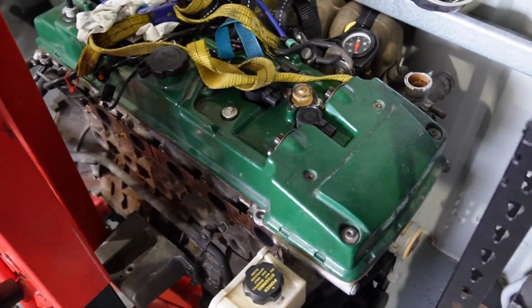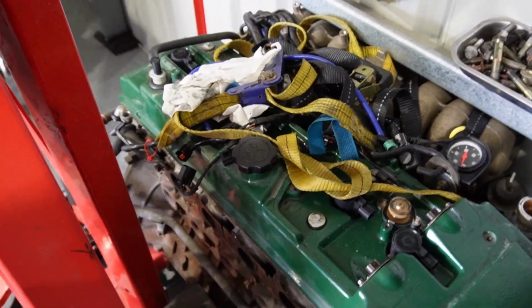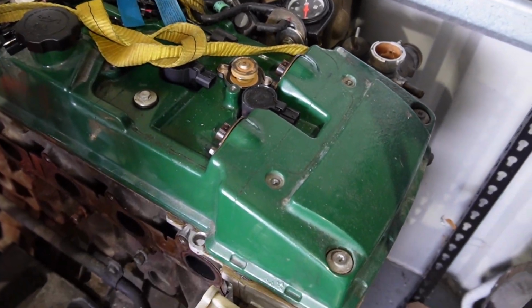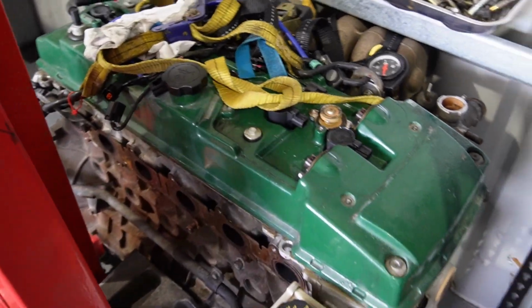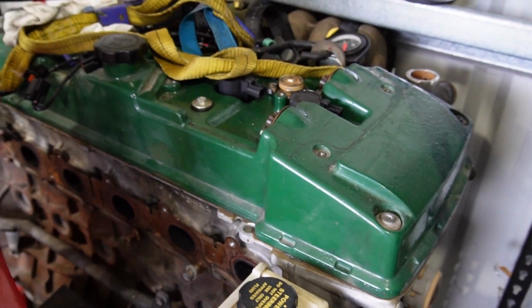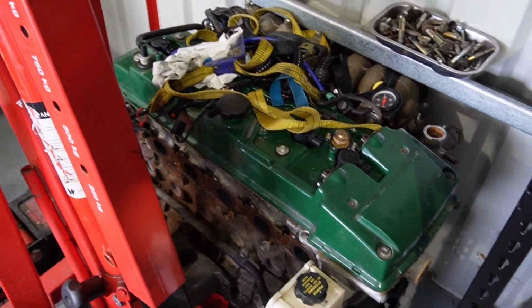And yes, of course, I have sourced the almighty Barra green top. It is only a BA, so I won't be pushing it too crazy, but it will be getting a full FG top end. So FG hot side, FG cold side. I'm still running the stock crossover pipe, and I will be running a stock airbox as well, because I want this engine bay looking stock XR6 turbo, because OEM plus.